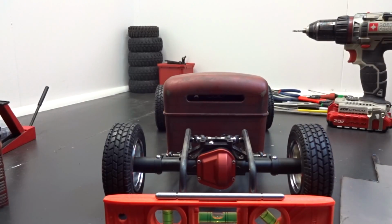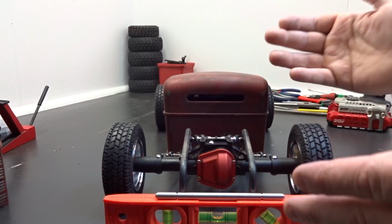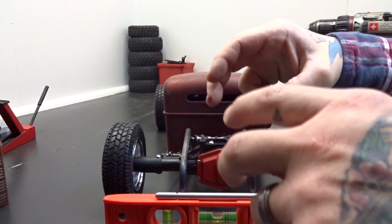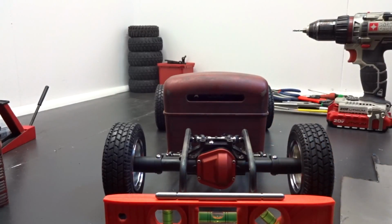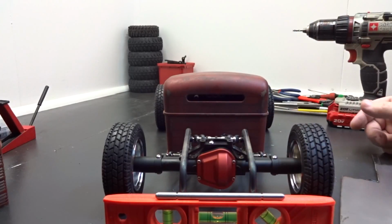From the back seat back, you can order, or a lot of people will make their own, but you can buy kits. That's the whole frame from the back seats all the way back, and it's already narrowed, it's got all your mounts for your 4-link, it's got shock mounts, and then you just pick the axle you want to put in it. Traditionally they call that back halving the car. So I'm calling it back halving the car because this is more what that would look like.